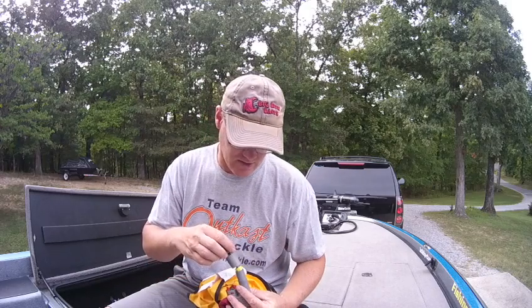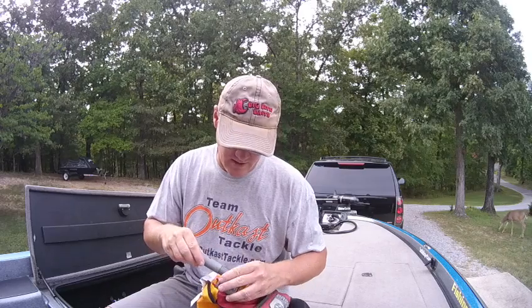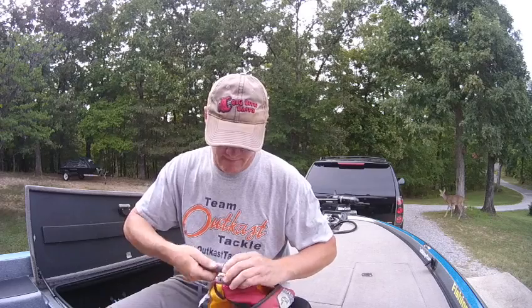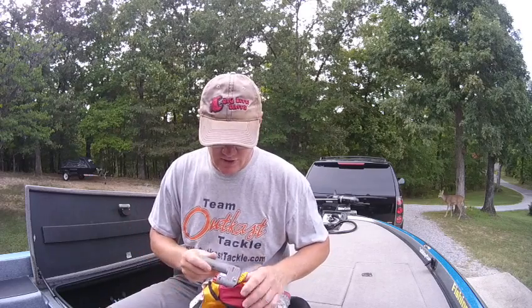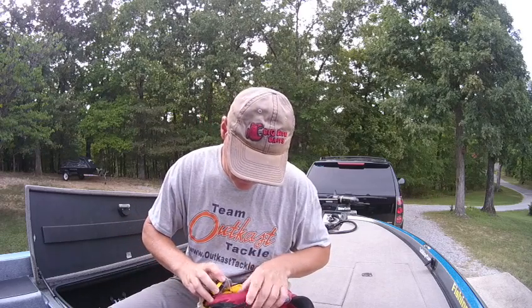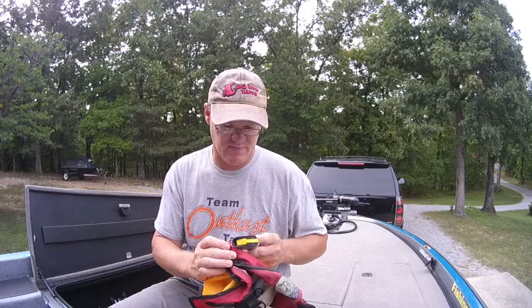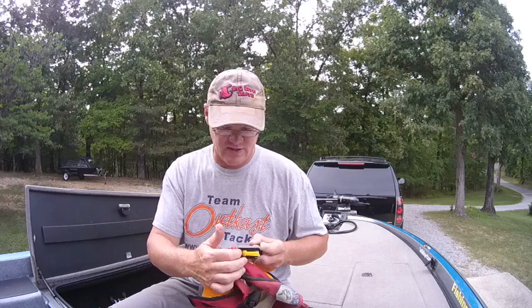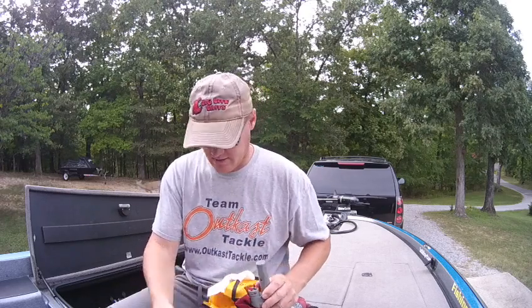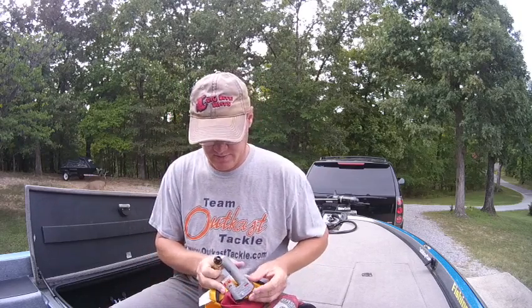There's little grooves on here. It shows you how it's got to go down on here. It won't go in until you get the grooves lined up. There, the grooves are lined up. And just twist it down. And I've noticed on here, if I push this down, it keeps that lever up there. As soon as I let go of that, you can see that lever. That's what happens when you give it the automatic pull. When this lever pulls down, it pushes these up, and that'll break the seal and push that needle up in there also.